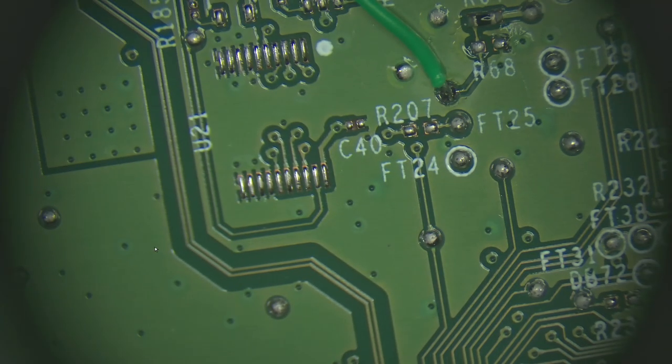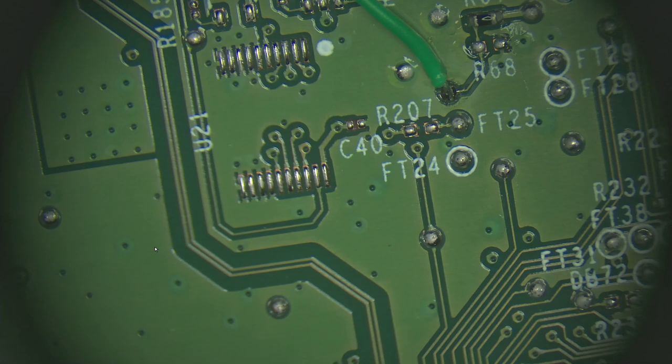Oh, by the way, this is what I was talking about on the rear side of the board. This is picking up the via of that NOR, pin 7, picking it up on the cold side of R68, as you can see there. Okay, so that's pin 7. Now flip the board over and put the other. This is the other board, this board E, by the way. This is the one we're going to convert to work on that machine. So technically I'll end up with two boards that will work on that one box.